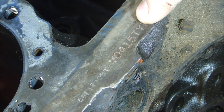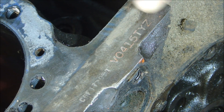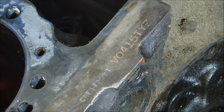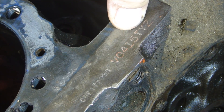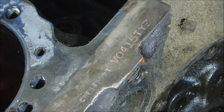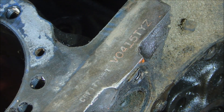The TYZ code tells me this was made for a 1975 truck, even though it's a 76 block, and it could be a C10 to a 2500 truck. It was 165 horsepower with a four-barrel carburetor. So that's what I know from all this information. I have my numbers, I can read them, it hasn't been decked, the serial numbers match, everything is good — I got the right year.